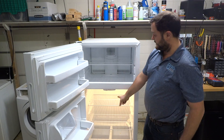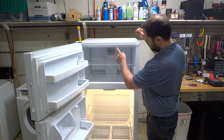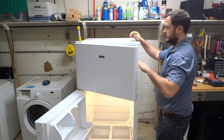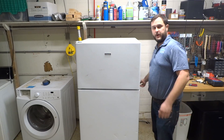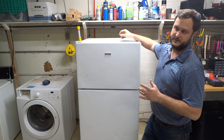You can see the lights are on, so you're pretty sure it's got the right power. When you open the top, you should hear a fan blowing if it's not cold at all. You should also hear something running in the back — your compressor — and there's another fan in the back. All that should be running when it's warm.